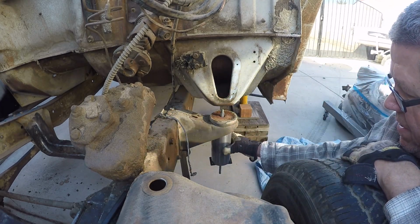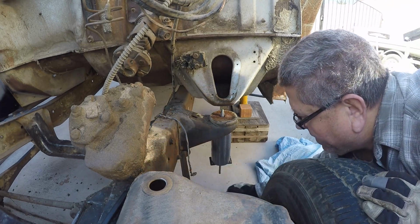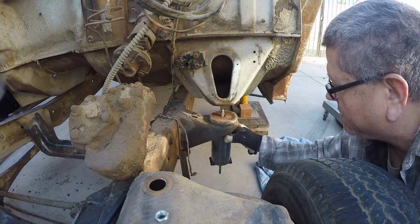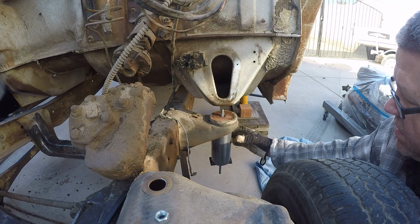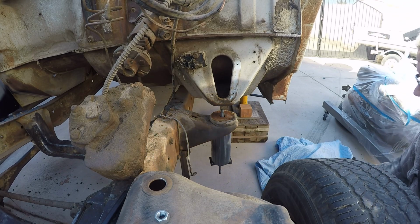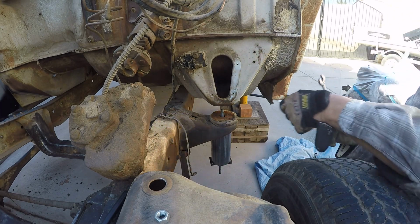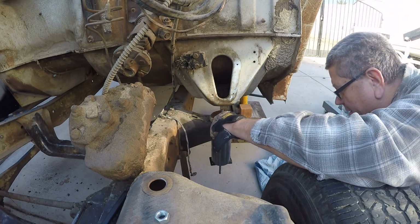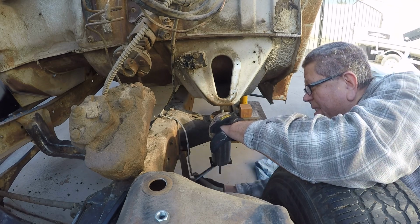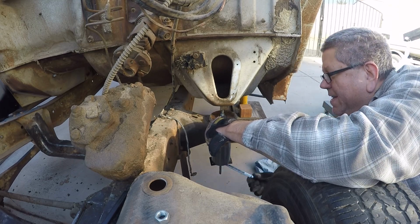There it is installed. That nut, one on the bottom here. You can see that's sticking out. Now that's putting pressure around the body mount that's identical to this underneath. And when you tighten this up, it pulls that thing right out. Now watch, it'll just pop right out. You hold this one, turn this in. You can use an impact if you want to, but this one, these usually aren't very tight.